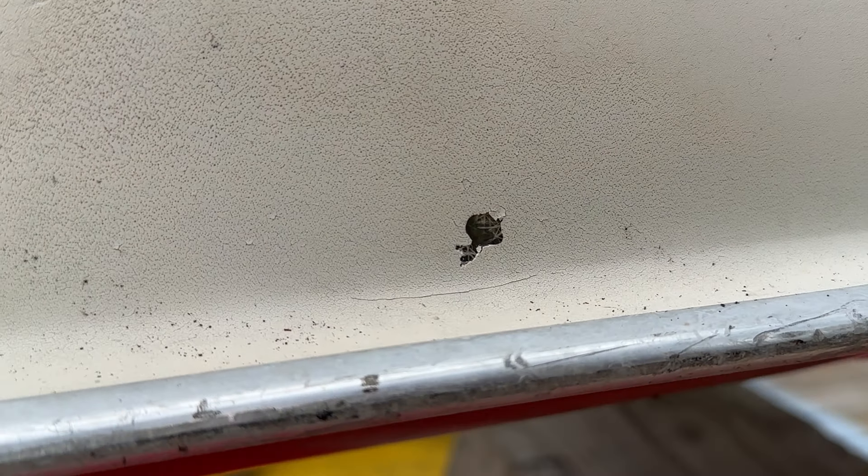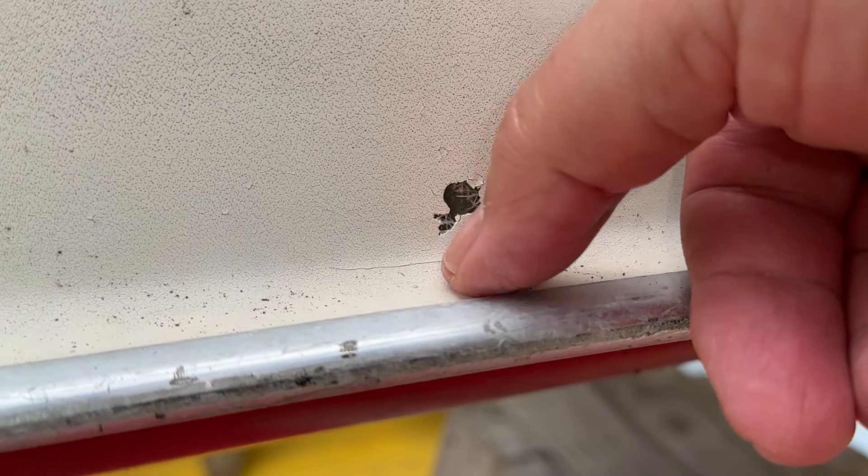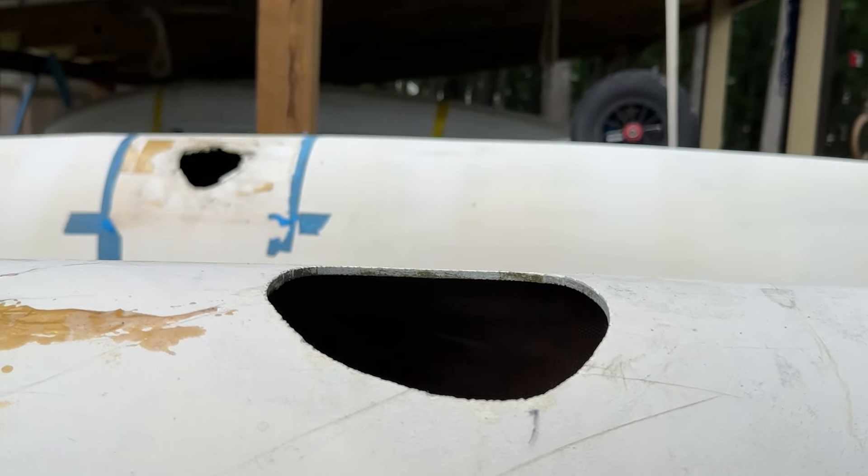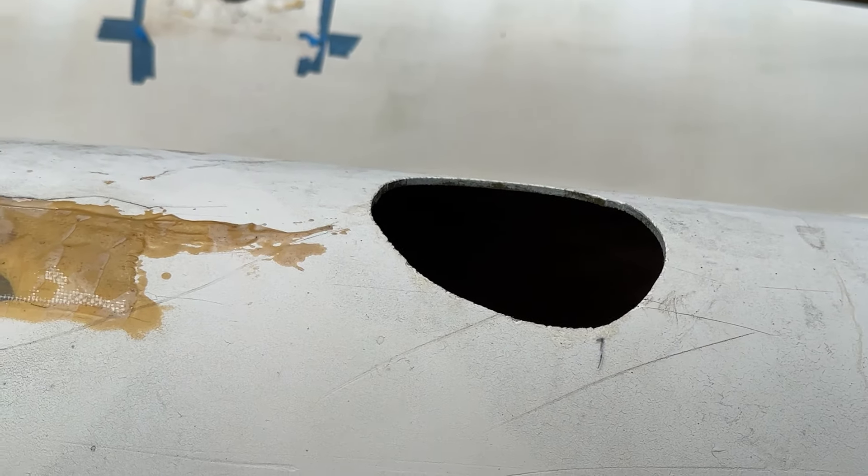Here's another one over here. Come out and we'll look at it. That's what you see on the outside — it might not look like much, but I can take my nail and the gel coat's gone. It's just a thin piece of fiberglass underneath. We'll need to get a gel coat repair kit to put that coating back on there.